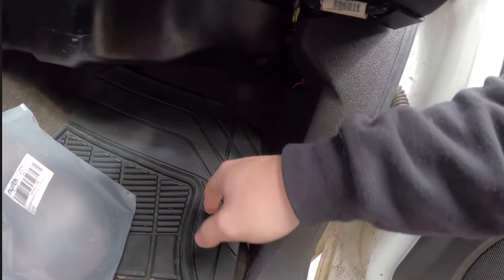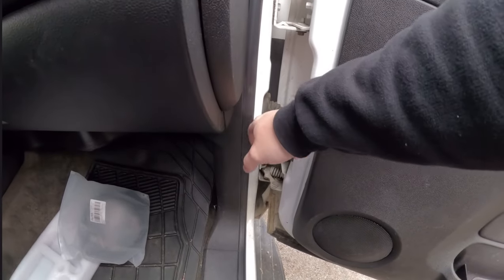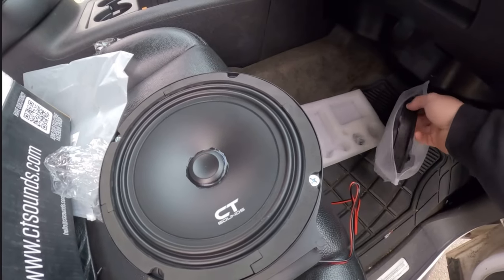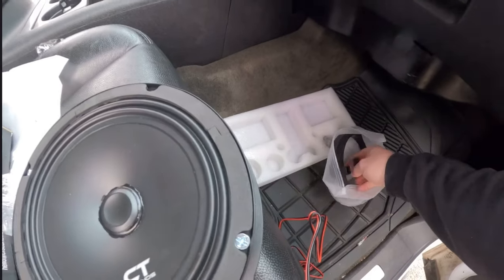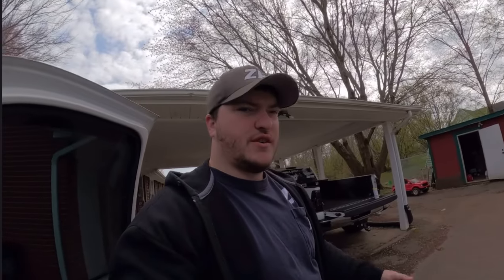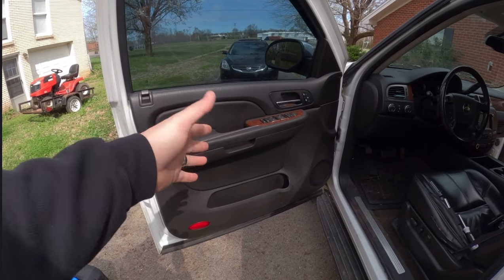The crossover fits right behind the panel — you can still see the wires a little bit, I just need to tuck them down a bit better. I also bought these adapter mounts that fit these speakers, and they came with wiring harness adapters so I don't have to hack up the factory harness. The hardest part is getting the wires through those little rubber boots, but I have a pretty easy method I'll show you. Let's get to taking this door panel off and get started.